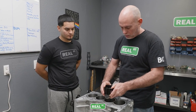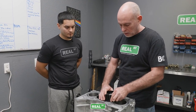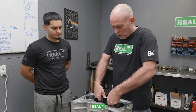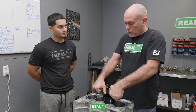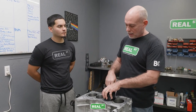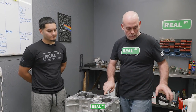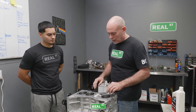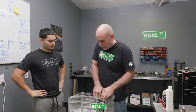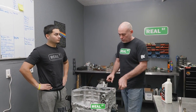You put the ring compressor flat on the deck. You take your thumbs, just boop, just like that. You wanna go fast because you're passing that through, and as you pass it through, you don't want it to bridge that small gap and stick again. So it's not a game of force, it's just a game of speed.